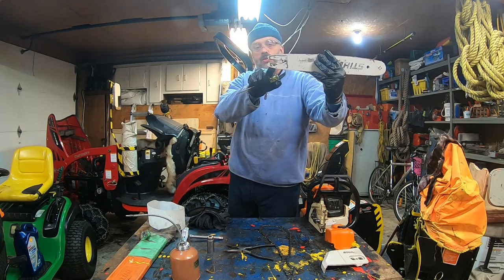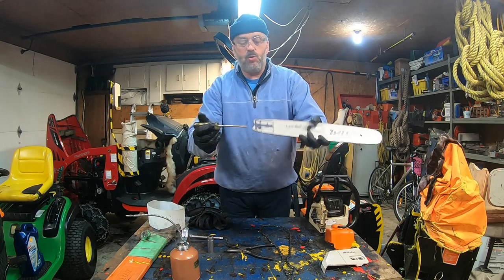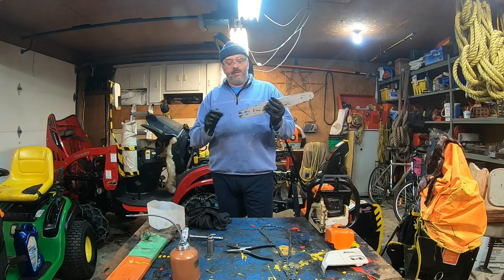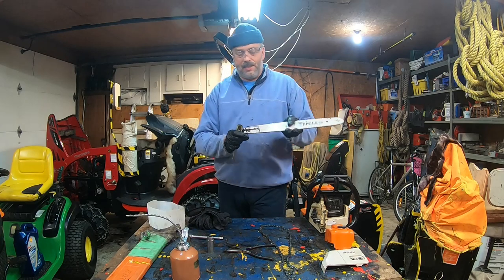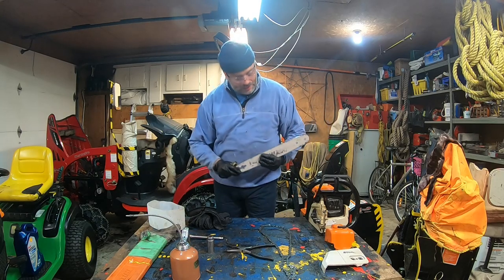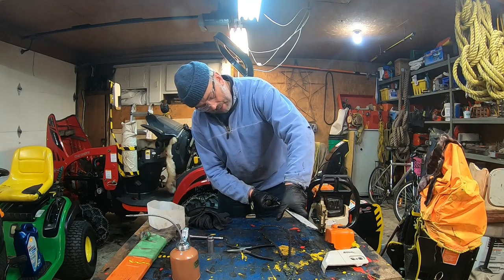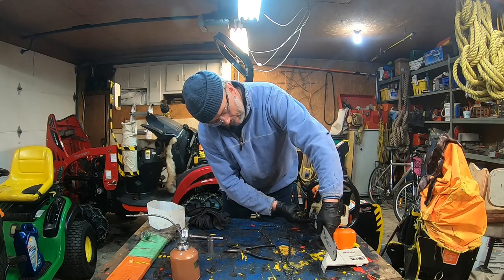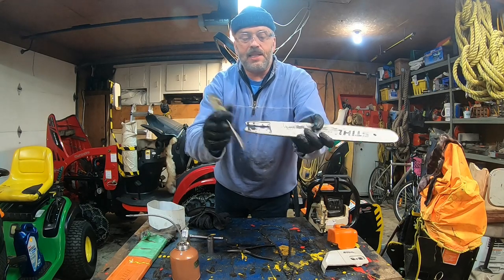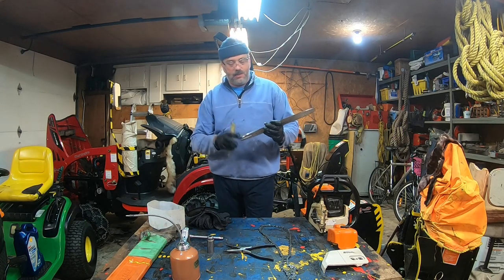Make sure that the oils, I know if you can see, there's two holes in there. One is there and one is right there. These all are very small and they're meant for lubricating the chains. And I'm not pointing the right hole. This is the big hole. Those two big holes there are for aligning. Just hold on. Just want to make sure. No, I was right. The two small holes, very small. This is where the oil passes to lubricate. So this is very important. You make sure that they're clean, okay?